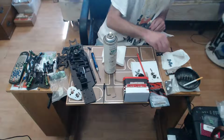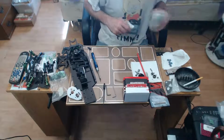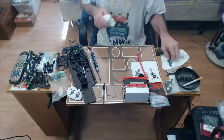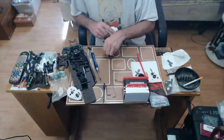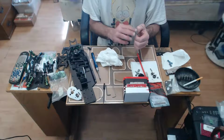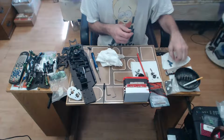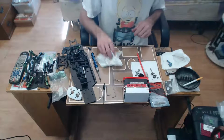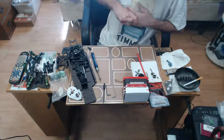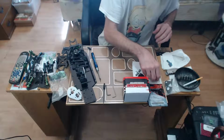And this is a silicone lubricant, a cleaner, a protectant. Works pretty well. So if you need to really clean out brake fluid, and this stuff's thin, it will work in between the seals and work into the inside, so it will lubricate inside and lubricate your ceramic bearings. Yeah, probably spray these once or twice as I get them ready to go in, because they'll need a couple of flushes and cleans. That was the other thing I forgot to do. I was so excited about putting this damn thing together. Took the new bearings out and just threw them in. Of course, they should have some lubrication, but you should always add a little bit, make sure they're right.